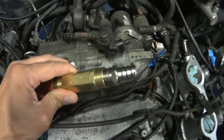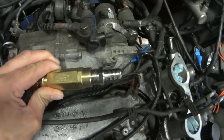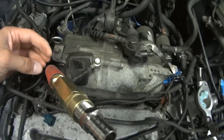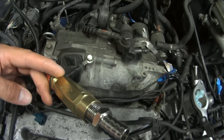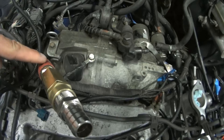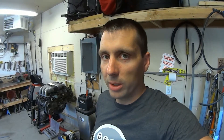So this actually opens one way at 0.3 PSI, and the other way it will not open — I've tested that, it works really well. The idea is that any pressure building up in the crankcase can push into the intake where any oily air will get burnt — no big deal. But if we have boost pressure, it can't get into the crankcase. If you're running a boosted application in your EG33, I would recommend doing something similar — that valve is probably $20 or $30 and I'll link to it in the description. Eventually I'll probably go with an oil catch can, and from there we hopefully won't have any pressure or oil issues on the intake side.